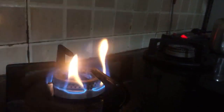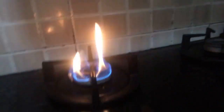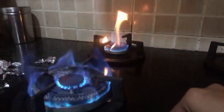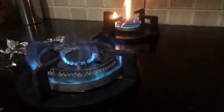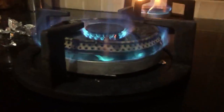You can see how the flame overflows everywhere — that's because the gas is leaking since the ring no longer fits properly. And the reason it doesn't fit is because you can see how badly bent it is.